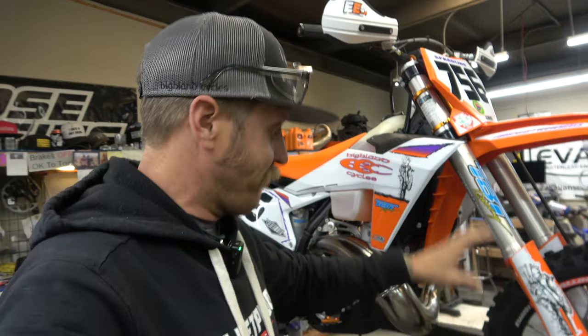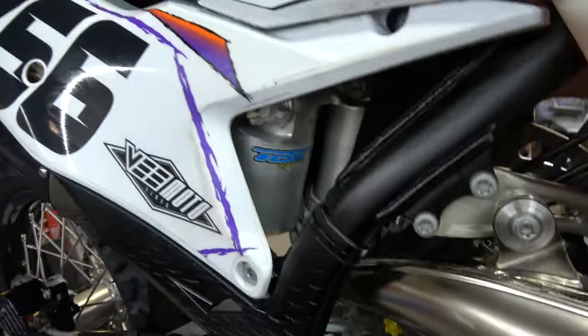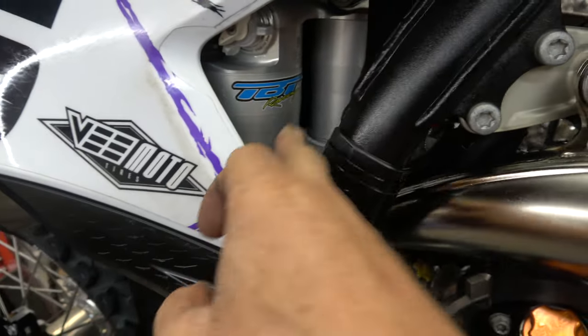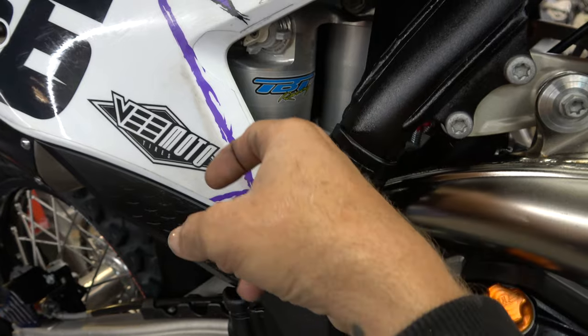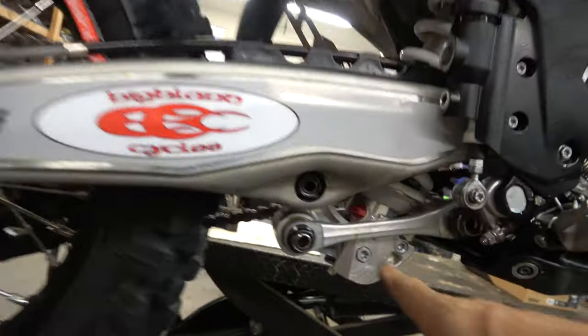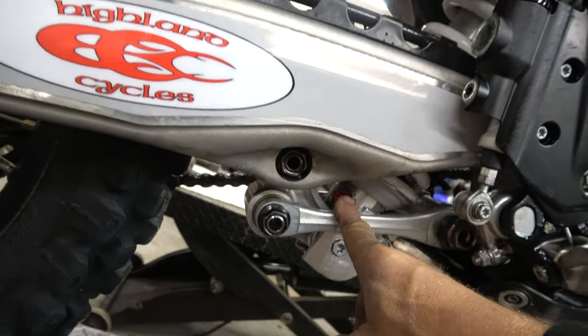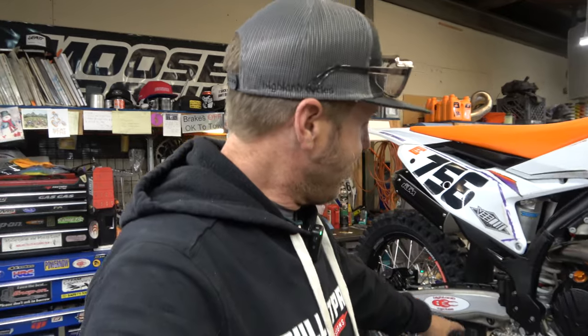TBT Racing is a huge sponsor. These are full revalve — still air forks — the brand new air fork with the Hydrostop setup in the bottom, and we've got the brand new shock with a bladder kit from WP — that's the official WP OEM bladder kit. Quick note: that adjuster that says you can do it by hand — that is not true unless you have tiny tiny fingers. So nice job KTM, but the rebound is not really adjustable by hand.